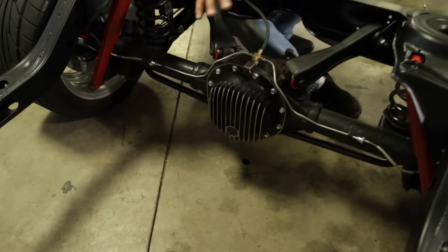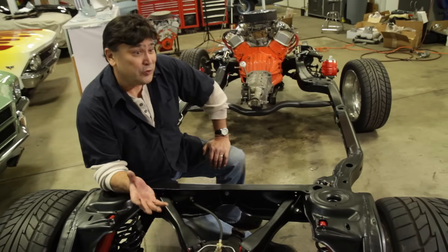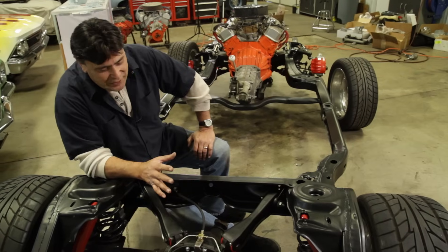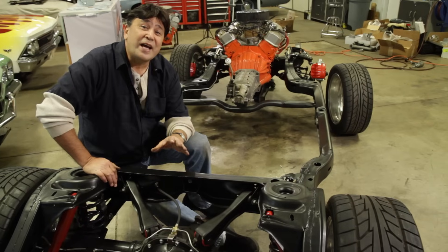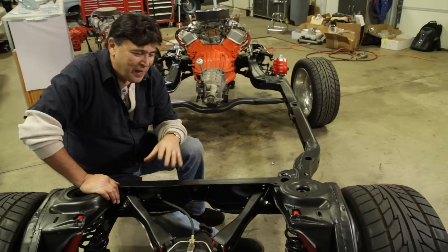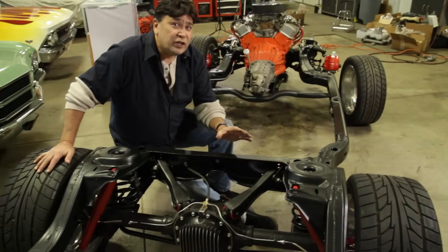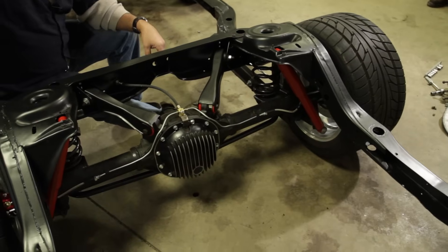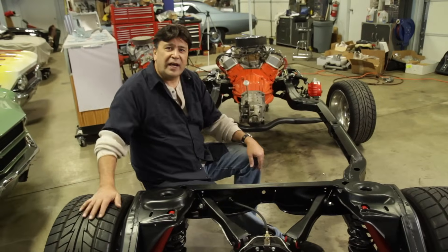The rear end - I got a smoking deal on it. That's a 12-bolt rear end that I also copped off Craigslist, picked it up for 800 bucks. I was a little bit skeptical about it, but it was a nice clean housing, and once I opened up the guts, was I surprised - 3.31 gears in that, baby, the perfect gear for what I got in mind. We also finished things up with the Right Stuff rear disc brake setup, and a set of lowering springs. That's basically what we got going on out back - a real budget build-up, and it set us up real nicely.